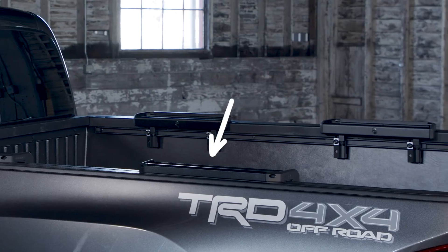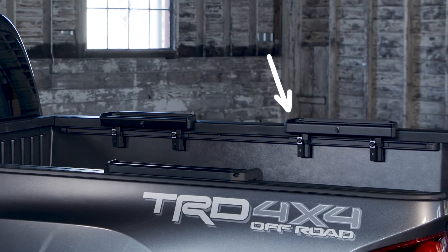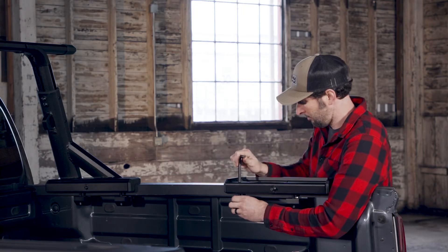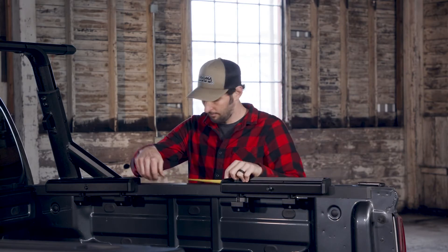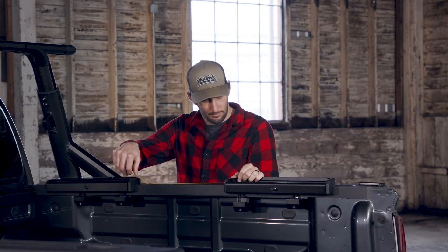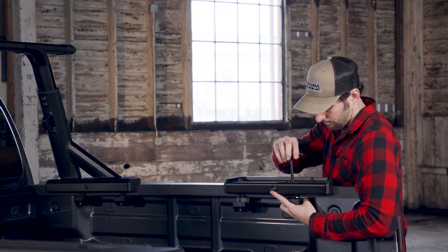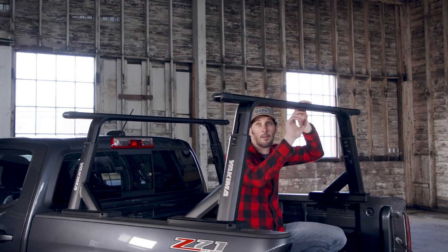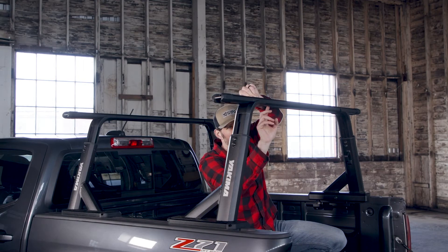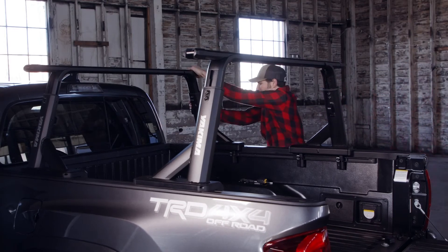Now repeat the process for the back of your bed — clean the rail, locking base on the driver's side, non-locking on the passenger side. Install the clamps and measure from the ends of your front bases so they're equally spaced, making sure they are far enough apart to give you at least a 36 inch crossbar spread. Space the clamps as wide apart as possible and tighten. Attach the HD bars just like you did up front and check your work at all four attachments.